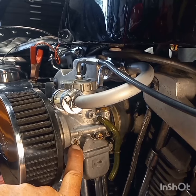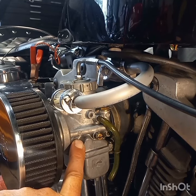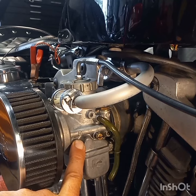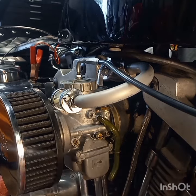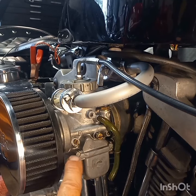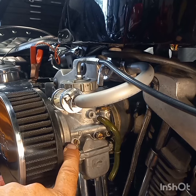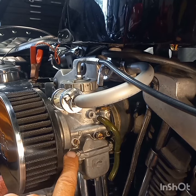That's where this air screw gets set and you never touch it again. The only thing this screw has to do with is your idle — so if you're not idling the way you're supposed to with this carburetor, that's when you'd mess with this. This is not a fuel/air mixture screw, it's just an air inlet screw.